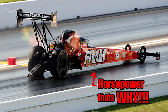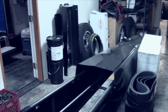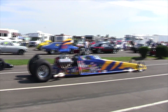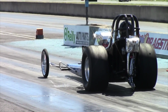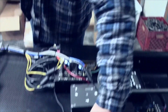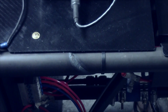It's good. The fresh pipe seems to work a little bit better for some reason. I don't know if it's mental or what, but a new car always seems better. I know they're different. You can build two identical cars on the jig and they'll act a little bit different on the racetrack. Really? Just the way they're welded or the tubing or something. So the pros will cut the cars off at this seam right here, redo the front halves, and then put the body back on them. They'll put new tubing in them maybe twice a year, just to freshen up the front half so they react.